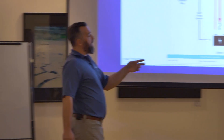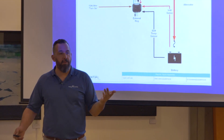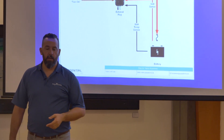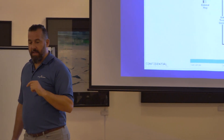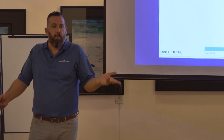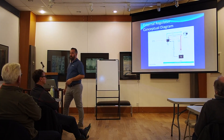That fuse is probably blown. If this doesn't sense volts, it's not going to turn on. It's going to say, why would I do work? There's nothing to charge — I don't see a voltage. So it's actually looking on a specific wire and asking what the voltage is. Not the power voltage — that's different. If it doesn't see a voltage, it'll say there's nothing for me to recharge, so I'm not going to work. And that's how an external regulator works.